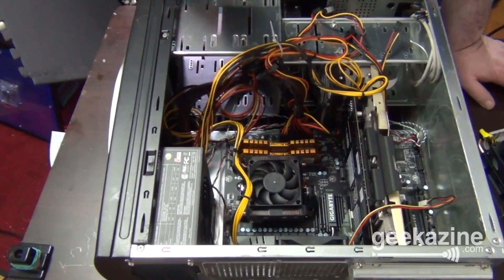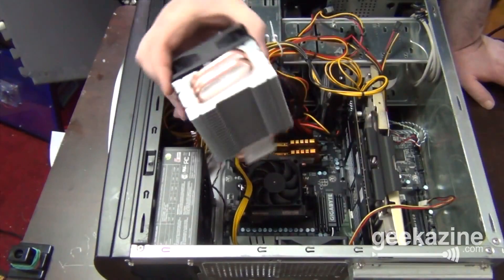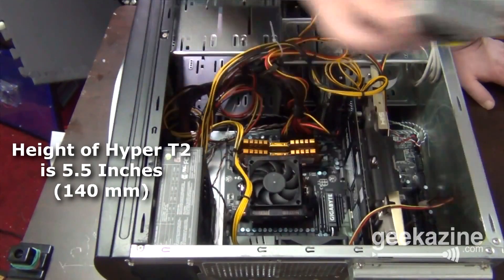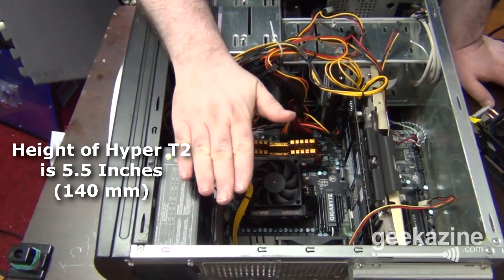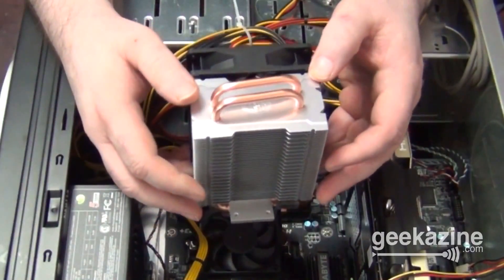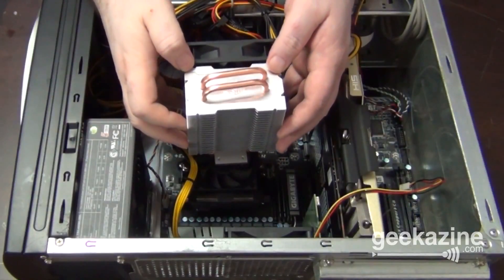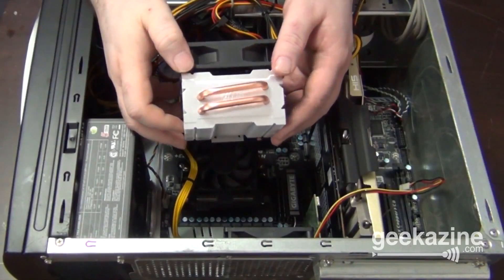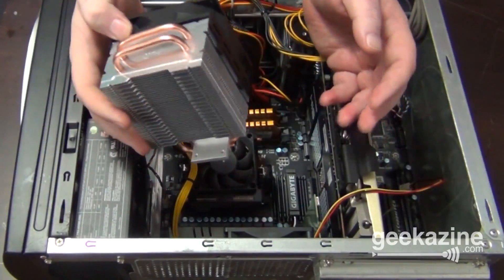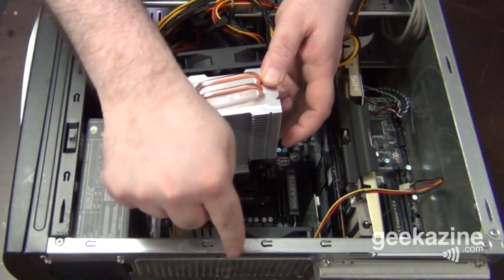So that's why I'm switching it out with this Cooler Master fan. The fan sits like this — standing on end. There are different versions of this, so you want to measure the case from where the processor would sit to the top of the case. You can also attach another fan if you really want it to be as cool as possible, especially if you're overclocking. We want it to set in here and be as quiet as possible in a fan system, otherwise I'm going to have to go to a liquid-cooled system. I made the measurements and everything looks good — it's going to be oriented so the airflow goes out the back of the case.